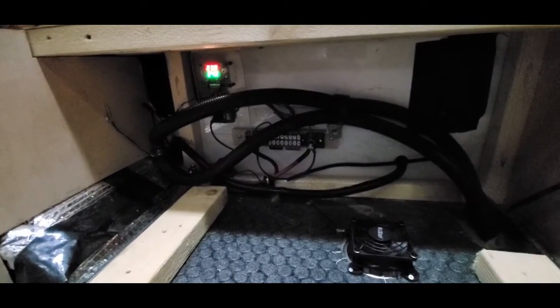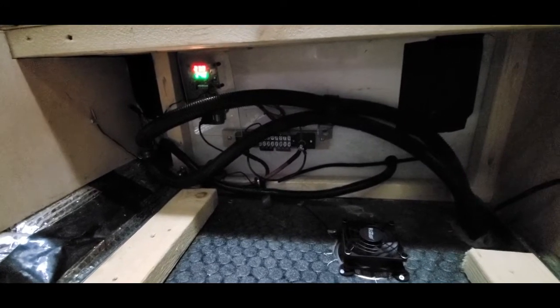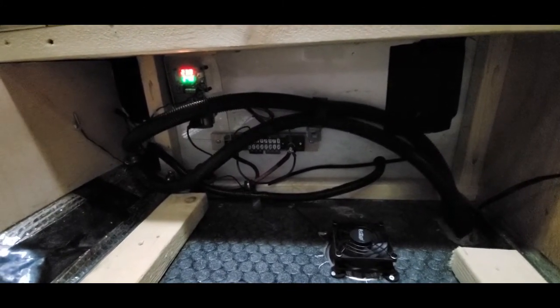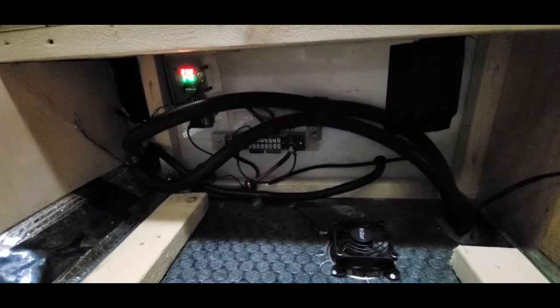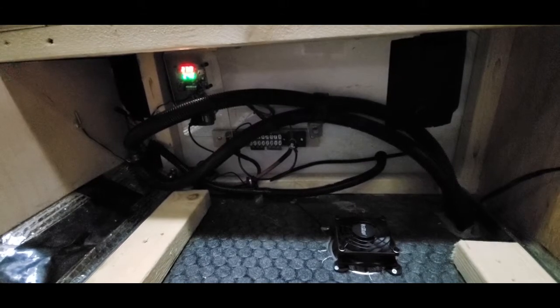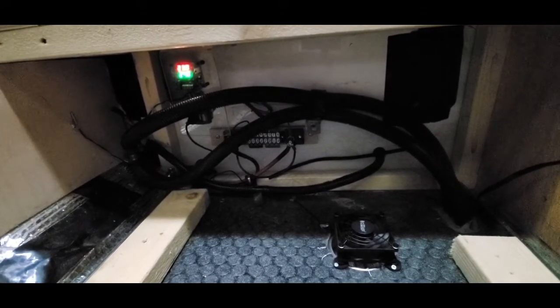To beat the low voltage alarms, I rewired 6-gauge cable from my circuit breaker to the back, and now my fridge freezer is connected to the 6-gauge cable, and I have not had a low voltage alarm since.